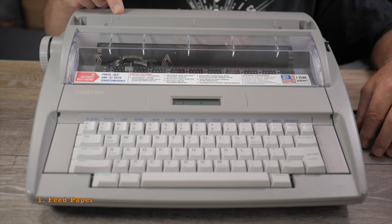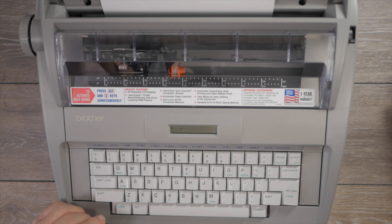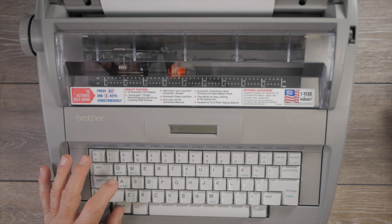Next, I'm going to feed a piece of paper into the machine, keeping in mind the arrow for the left edge of the paper. I'm using standard letter size paper — this machine is configured for American letter size, eight and a half inches wide. The margins default to an inch in from either side. Place the paper in the slot, align the left edge with the arrow, then you can either turn the platen knob manually or do an automatic paper insert by holding the Code key and the A key. It will move the carrier to the middle and feed the paper up so the first printing line is about an inch below the top edge.